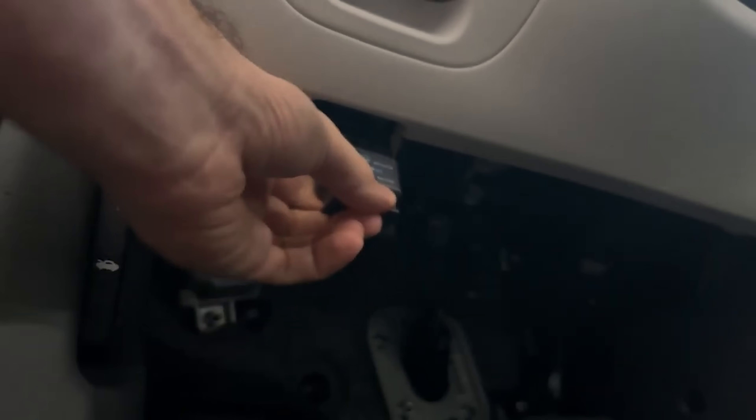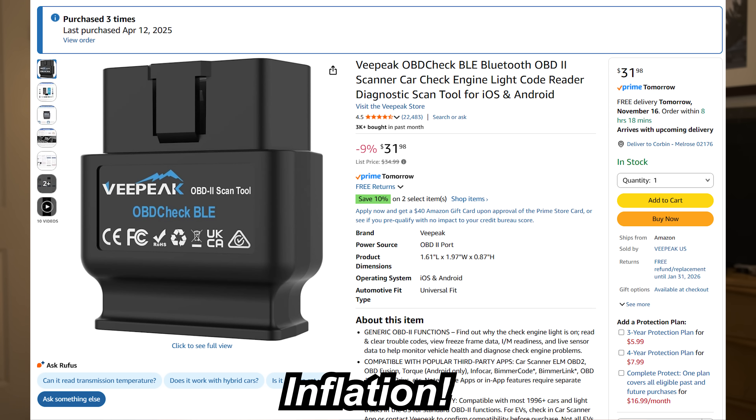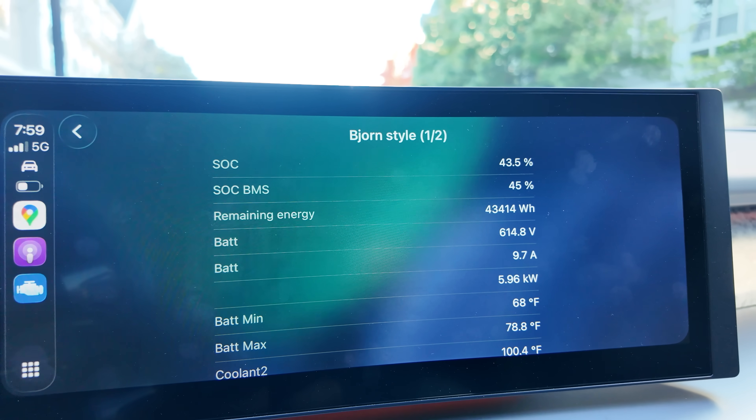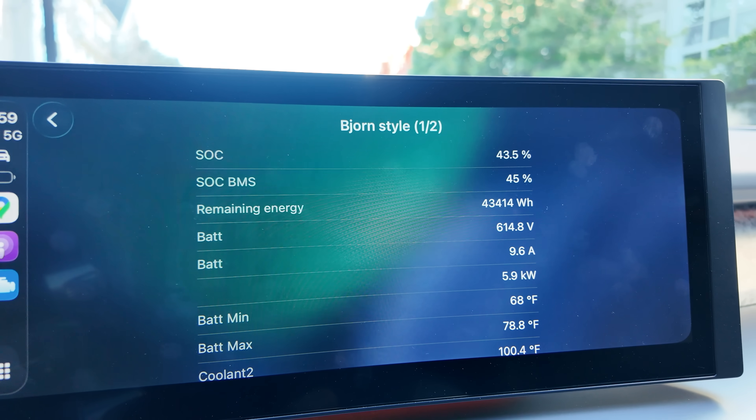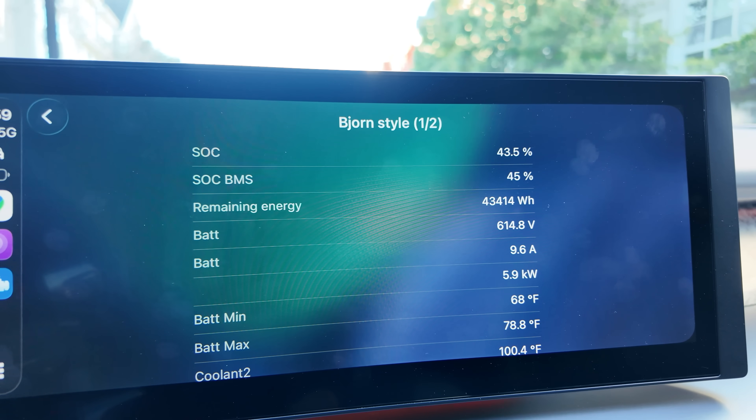There is a much better way to actually know your battery temperature — through an OBD2 Bluetooth dongle that plugs into the OBD2 port on the car. I've got a video about this process if you want to do it yourself — I'll put a link in the description below. These are cheap, about $25 on Amazon. If you're using CarPlay or Android Auto, there is now a Car Scanner app, which talks to the wireless OBD2 scanner and displays all sorts of car data on the CarPlay or Android Auto screen. You can really watch that battery temperature and see how quickly it's dropping or coming up.